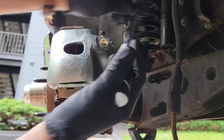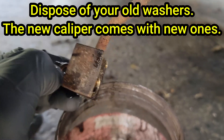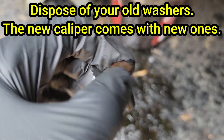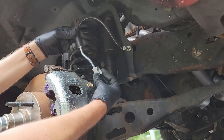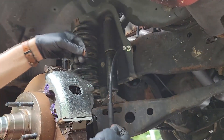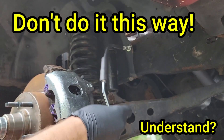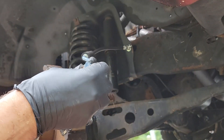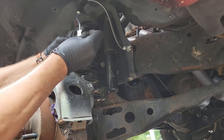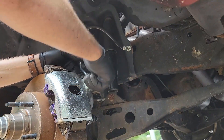All we need to do is connect our brake hose and then bleed the brakes. Make sure you save the bolt that should still be attached to your old brake hose — it should slide right out. I recommend getting new washers, since it would be frustrating if you complete everything, bleed the brakes, and then find out it's leaking around that hose. Now position your inlet block onto the caliper so you know which way it goes, then go ahead and remove the cap for the caliper — this also contains two brand new washers. Grab the two copper washers and put one on each side of the inlet block. It's much easier to put the bolt through like this and then place everything onto the caliper together, rather than trying to keep everything aligned while screwing the bolt in from the other direction — that can get annoying.